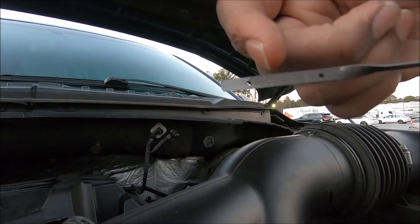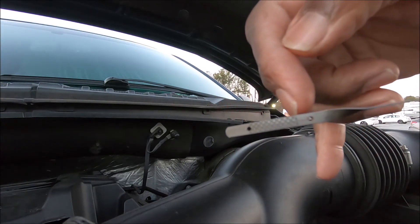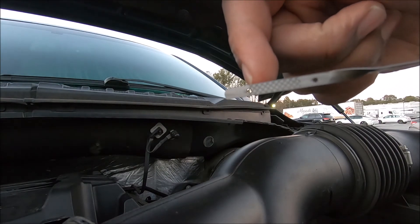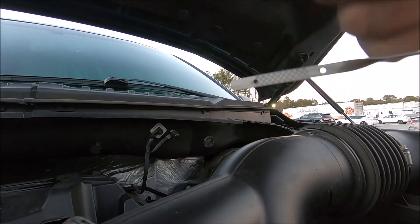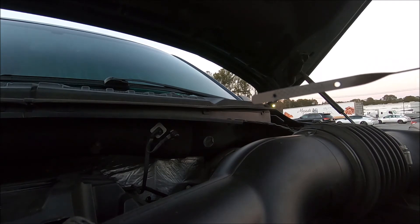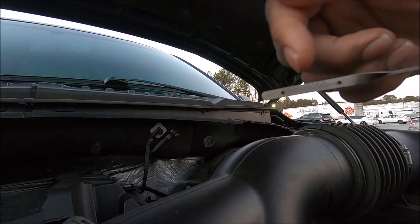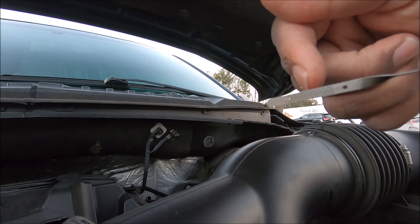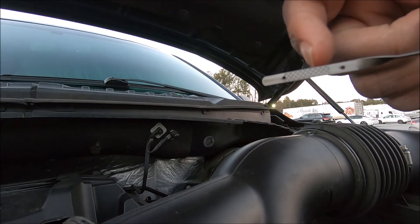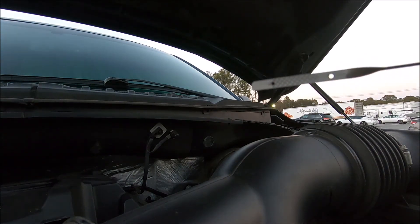Remember, in my video about the track trailer, I noticed you couldn't see the crosshatch. The crosshatch is here to here. On this truck, from here to here is like two quarts. So if the oil is in the middle and it's not too hot outside, you don't really have too far to go — you can drive it. It's not gonna tear up. I would feel safer if it's right at the top, but if it's in the middle you can drive where you need to go. If it's really hot and you're pulling a trailer, you might want to fill it up. It's supposed to be safe anywhere in the crosshatch, but I wouldn't let it go any lower than the bottom mark.